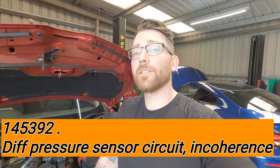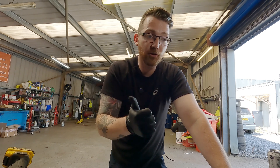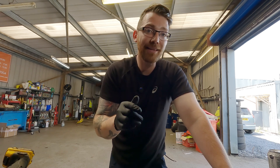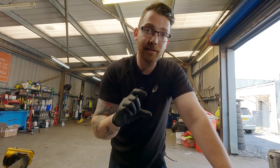This came in for a lack of power and the engine management light on. When we scanned it with our diagnostic tool, it's coming up with an issue with the differential pressure reading for the DPF. Looking at live data, it's telling us that there's no soot at all in the DPF, which is unheard of for any of these diesels, and that there's no differential pressure. So there's an issue with the sensor, and there's a very common problem with these engines to do with the pipes that go to that sensor.